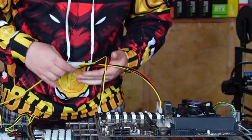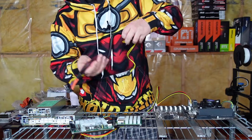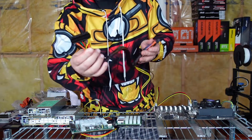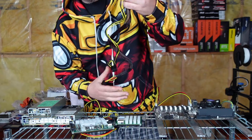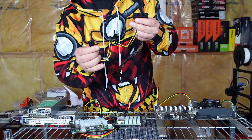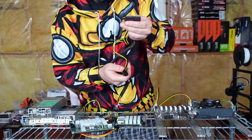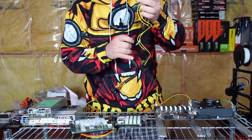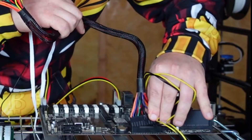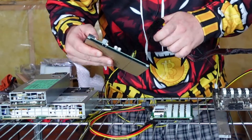The molex ports are now powered. Next up we need to install the 24-pin connector. This can go in either direction — you can plug either end into the motherboard or the ZSX. This end also has your CPU power cable, and you must plug in the CPU power cable. Some people forget that and wonder why their board won't boot — you have to power your CPU, not just the 24-pin.